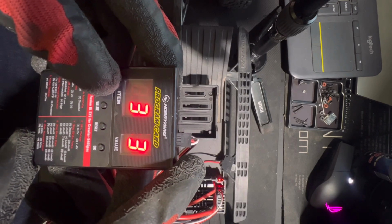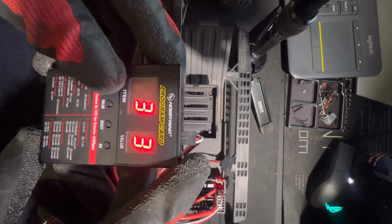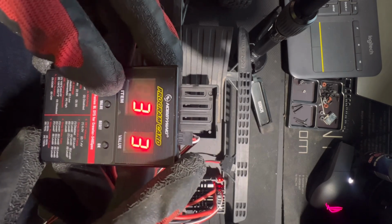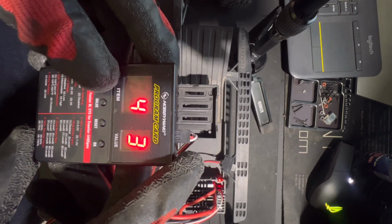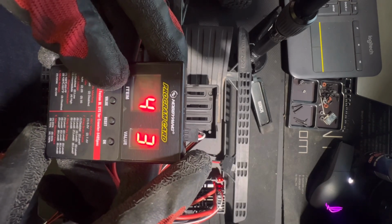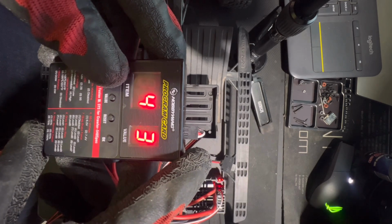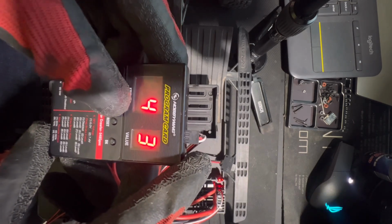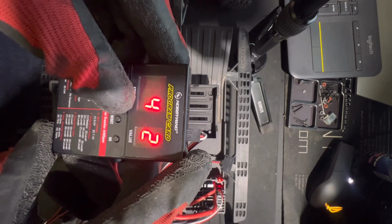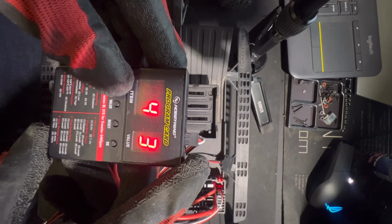And I would also do that if I put any brushless systems over here, just to protect my batteries. I'm not sponsored on batteries, and these batteries are quite pricey, so we don't want to damage batteries. Option number 4, the initial start force, was set to option 3, which is 4%. And I see over here it has 9 options, so let's just check the values that it goes through. Okay, we're not going to save that.